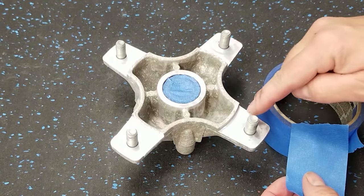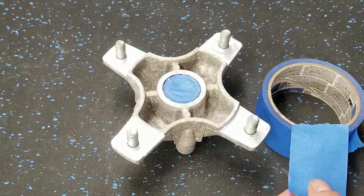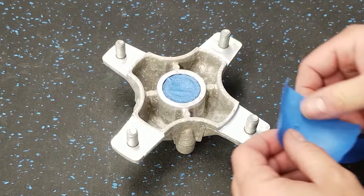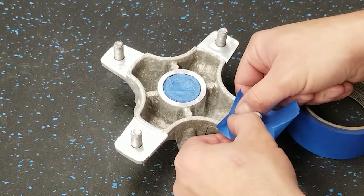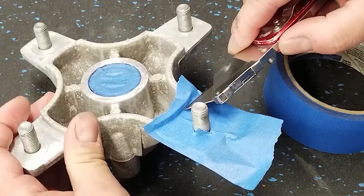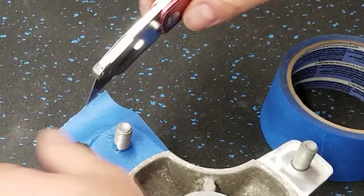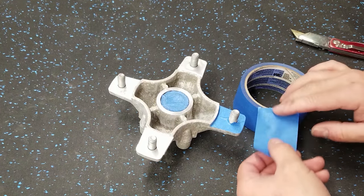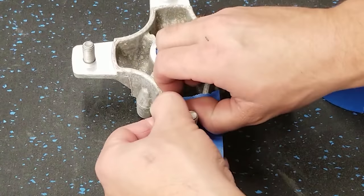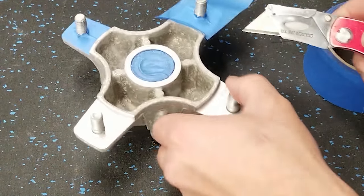Now I'm going to mask off all these areas - the faces of the hub where it contacts the rim. A good powder coater will mask those areas off, so we're going to do the same thing with paint, and we'll also mask the threads on the studs. I bet this will last quite a while. A lot of people would powder coat these, and if I had the facilities here I'd probably do that too. What we did with the Scotch-Brite wheels is kind of like a poor man's sandblaster. This is not the first time I've painted hubs this way - they hold up. The banshee's hubs have been like four years and those things look great.